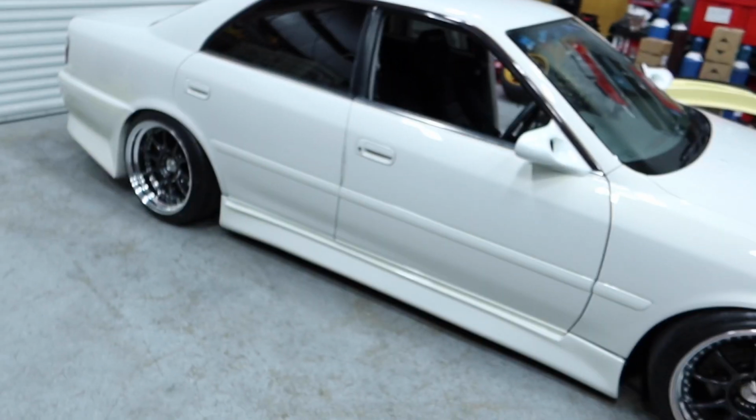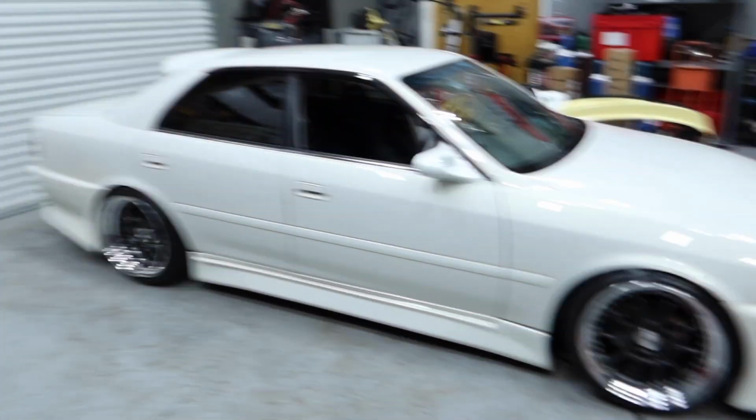Yep. Alright, so before I fill you guys in on what I've been spending my entire day on this stupid thing, Alberto's going to give you guys an update on the whole JZ thing. So like we said earlier in this video, we are going to be doing a 1.5 JZ. If you're not familiar with that, that is essentially taking a 1J head and putting a 3-liter bottom end from a 2J on it.